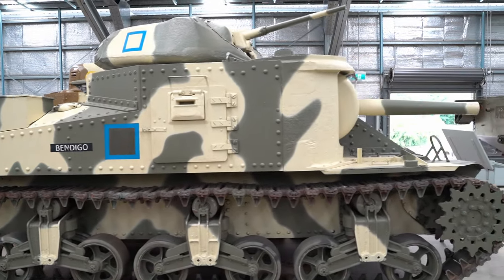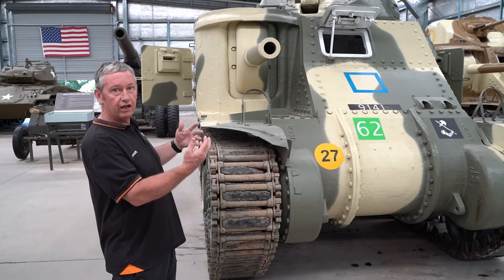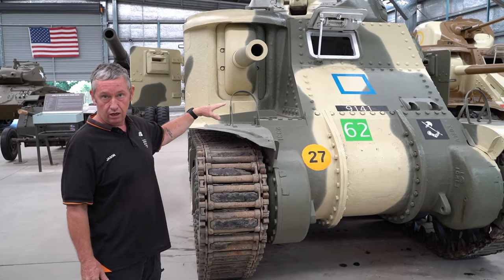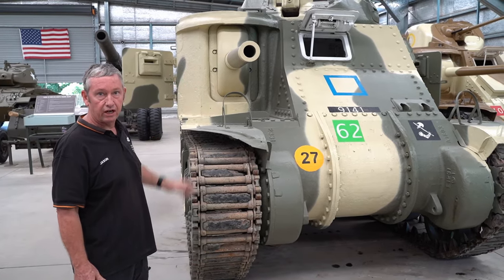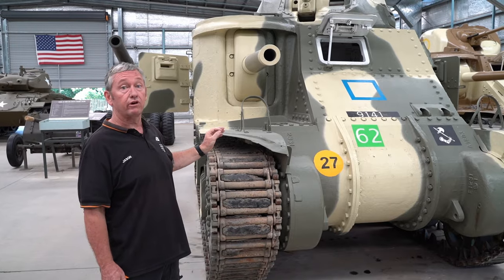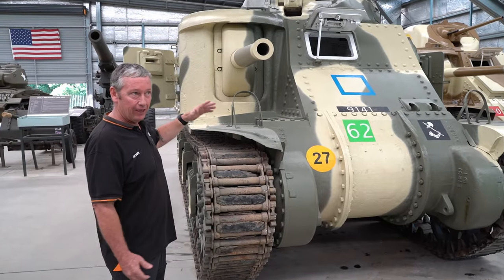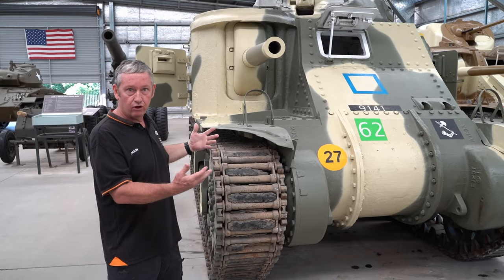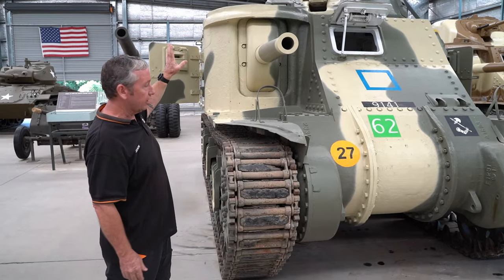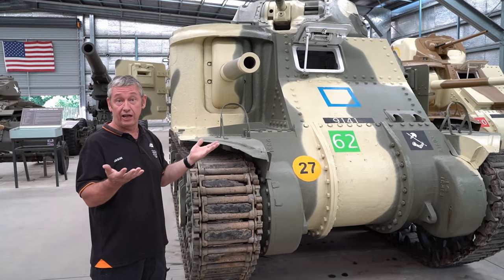This was essentially a medium tank — a stopgap — because at that point when the Second World War was commencing, they didn't have the machinery or tooling to put a fully rotating turret with a bigger gun, that being the 75, on top of the vehicle. So they essentially just had the sponson gun to start off with. The Brits used these in North Africa — the gun was comparable going up against Panzer 3s and 4s at fairly good ranges, even though it was only a medium velocity 75. The only problem was the design used the Continental R975 radial petrol engine — a massive aircraft engine which makes the tank a lot higher, because you've got a drive shaft going from the rear all the way to the front transmission, making it a very high vehicle that stands out, especially in the desert.